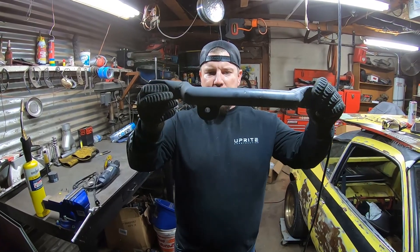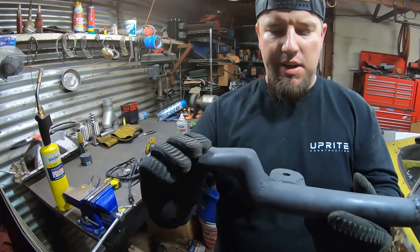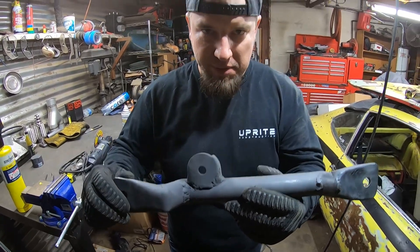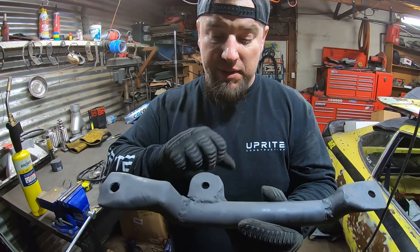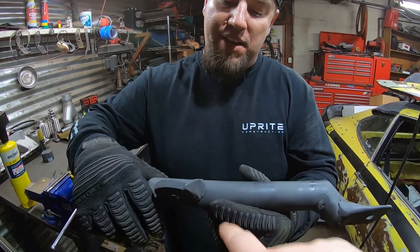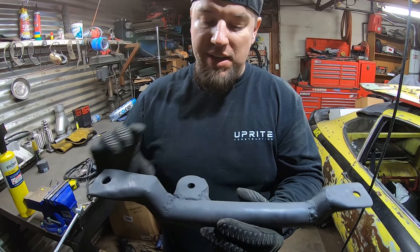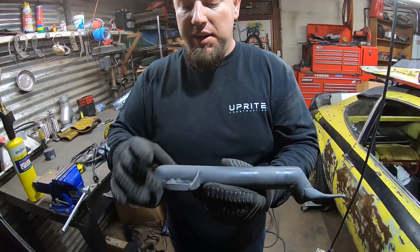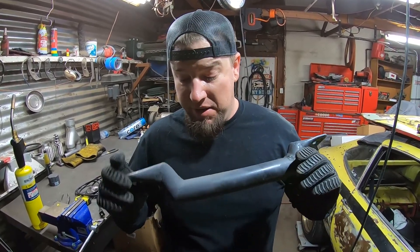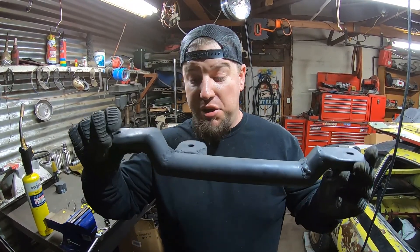How's it look, D? Looks solid. And it's solid — it's ugly, but it's solid. It's definitely welded all the way through, nice and stiff. We're not looking for a beauty contest here, we're looking for solid, and that's exactly what this is. We added a little gusset to the side after we got the tab welded in solid, just to give it a little bit more stability. With it being kind of offset just a little bit, we wanted to make sure it had a little bit more structure. So we're going to get this thing mounted back in place and get the transmission mounted to it so we can measure a drive shaft and see what else we can get into. There is our transmission crossmember — the motor and tranny are hanging in the car under their own weight right now.